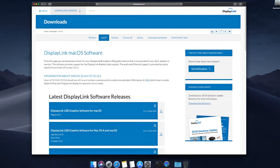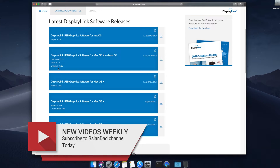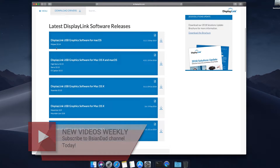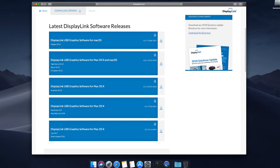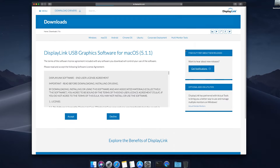The first thing you need to do is download the DisplayLink macOS drivers for your macOS version. I'll put this link in the description below. You need to match up the correct version of macOS you have — more than likely you are either running Mojave or High Sierra. Just download the appropriate one. It will download as a DMG file, and you pretty much just click on accept and it'll start downloading the DMG file itself.